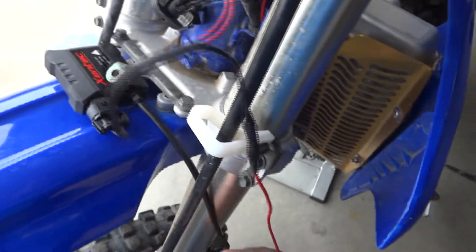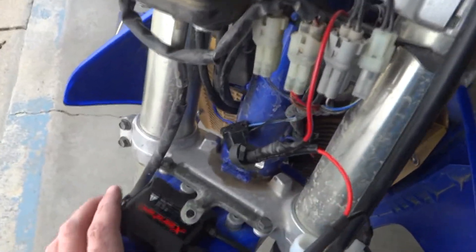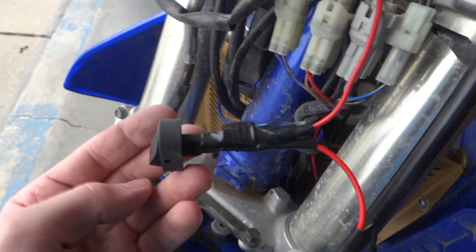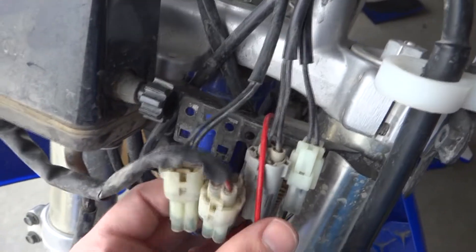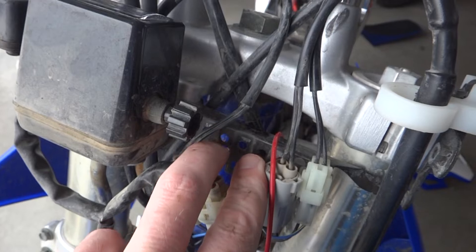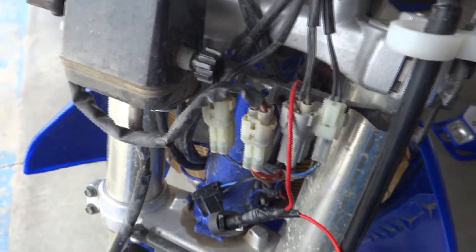I'll run the ground — also using red wire but I'll put electrical tape on it so I know the difference — all the way back to the negative on the battery. If you want the LED indicator light to come on, you also run a wire from this little post here back to the battery, then the LED will turn on so you know when the light's on or off. I'm going to fab a mount for the ballast and the LED switch right up here on the frame.